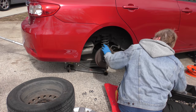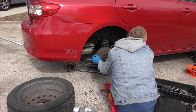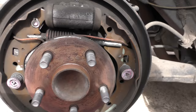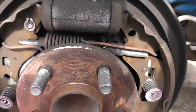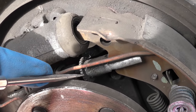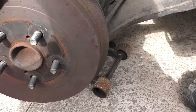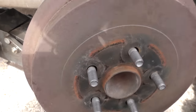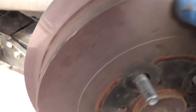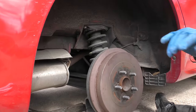That wheel spins really free, so I'm going to check the drum brakes. We'll get the drum off. Still lots of shoe left, it's thick, but a lot of times they won't tighten up right. Right here's the adjuster screw — we'll try to tighten it up a little. Hear it clicking. It slid on too easy and it still spins, so it needs to be tightened even more. Pump the brakes now — you can hear it dragging. Now that's just the right tightness; freely spinning, it's tight enough. It's dragging — you want a little drag.